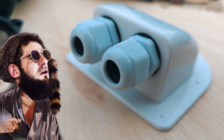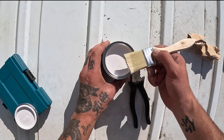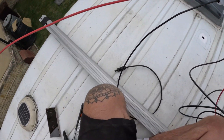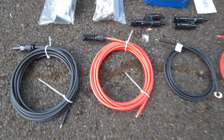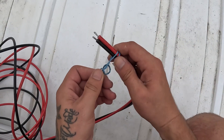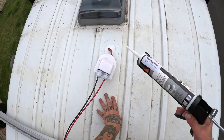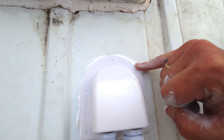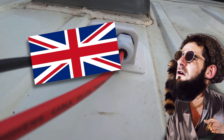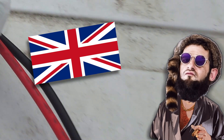We're going to be using this waterproof outlet to keep everything nice and watertight. I also recommend using a little bit of exterior metal paint around where you drilled for a little bit of extra protection. Now we've got to feed the main wires through — which are the longest ones in the kit — making sure to feed the right ends through the roof. To seal it all down we'll be using this Sikaflex waterproof adhesive sealant, specially designed for motorhomes. It's also quick drying if you're impatient like me, and being that this is the UK, that could prove kind of useful.